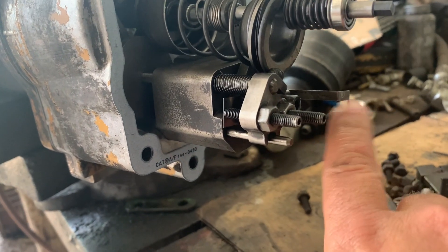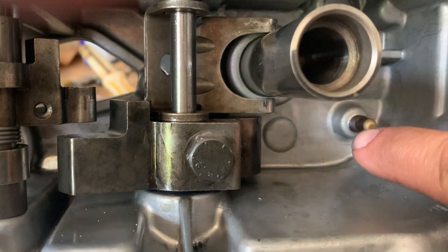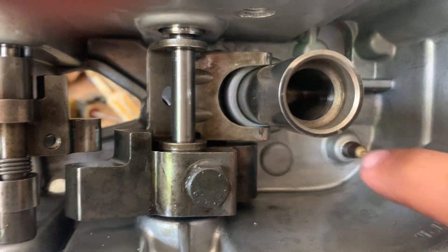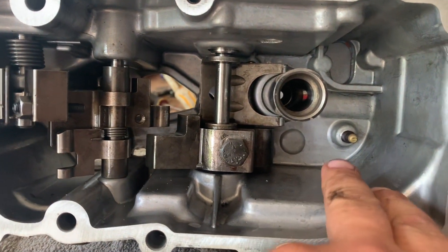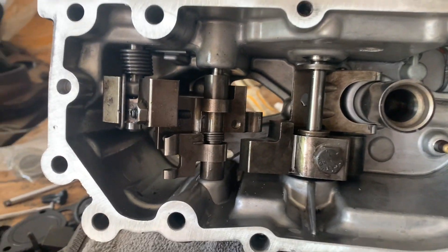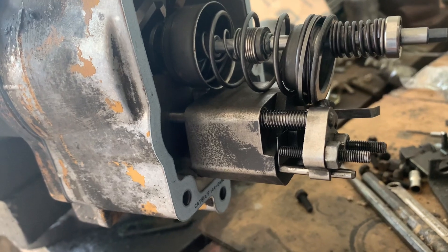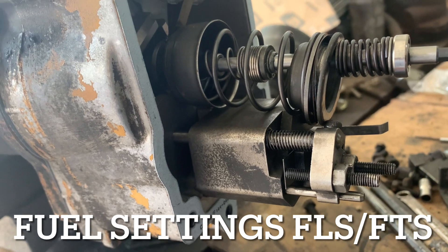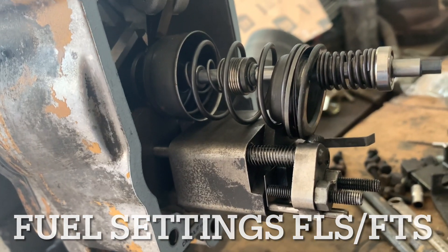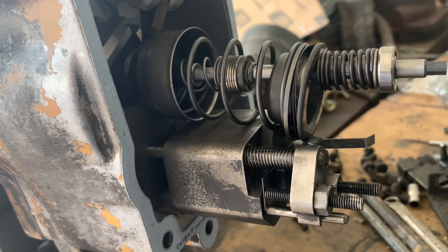You want to make sure that this does not get bent when you put it on there, because that contacts that little fella right there. So when the light comes on — when that touches that — it gets continuity and that tells you your first setting. That'd be your FLS. And then whenever the dial indicator stops moving, that's your FTS.